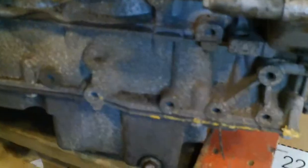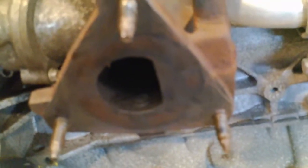I took out the heat shield with just one 15mm bolt, and that allowed me to get the grinding wheel in there better — it looks pretty good, all cleaned up. It should seal nicely. I'll put the oxygen sensor in and the top heat shield back on. I'll leave the other one off since it's going to get in the way. Heat shield's back on. I've put liberal amounts of anti-seize compound on the studs and got the heater hose connections and top radiator hose cleaned up with the wire brush. I also cleaned up the flange so no grease gets between the engine and transmission. Now it's ready to go in the car.